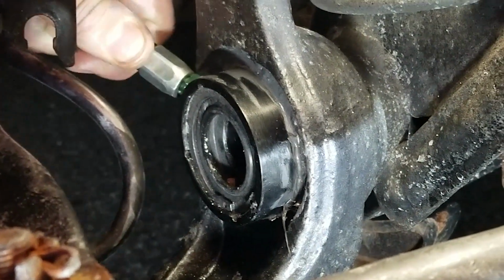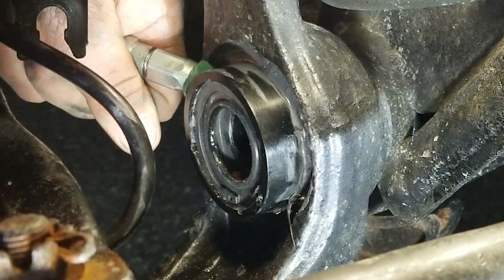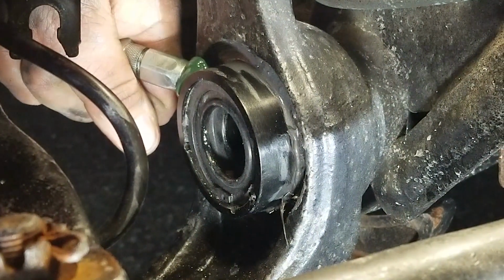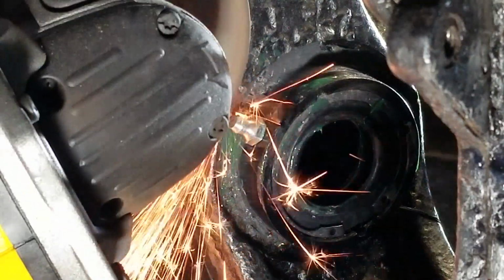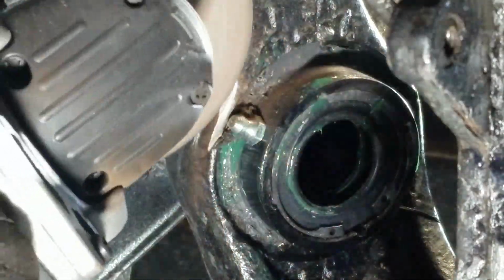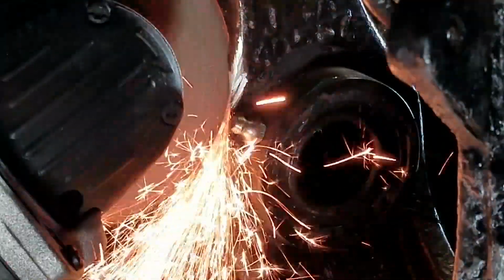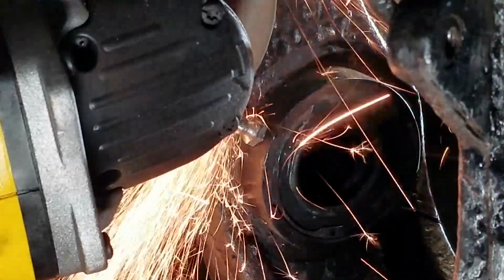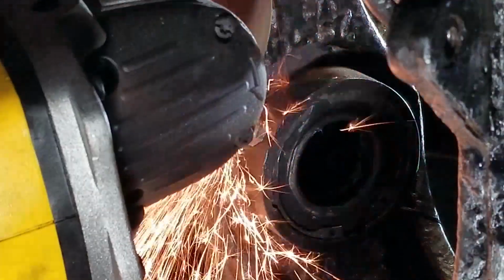Now I don't know if they make low profile grease guns, but I certainly don't have one, so there was nothing else to do but to try to clearance some of that meat off the Dana 30. Right now, there's no way I'm pulling that axle seal back out, so I'm trying real hard not to grind down the lip of that grease fitting. Took a little while, but I got it, and of course, I gave it a little spritz of some spray paint to help prevent rust.